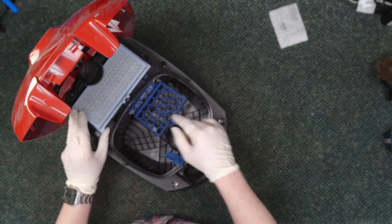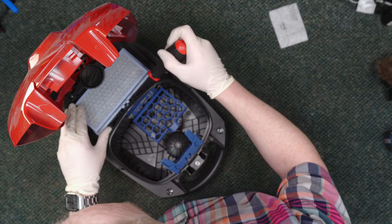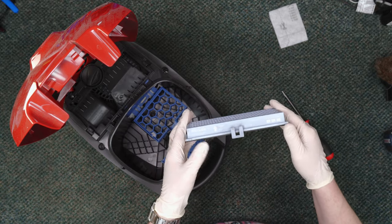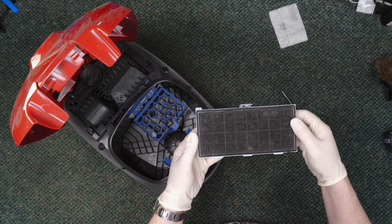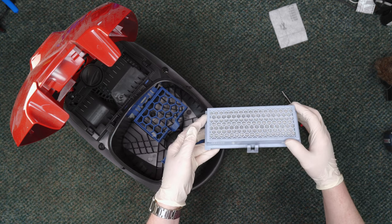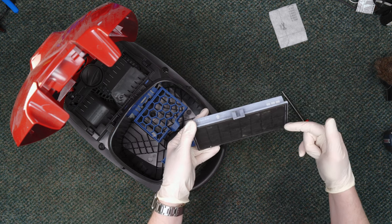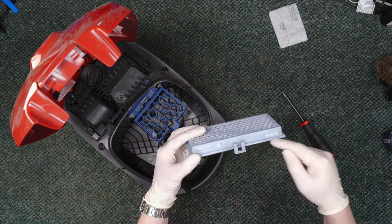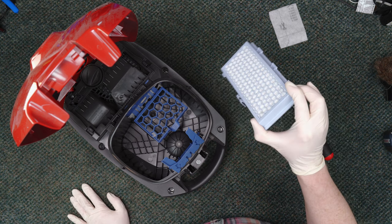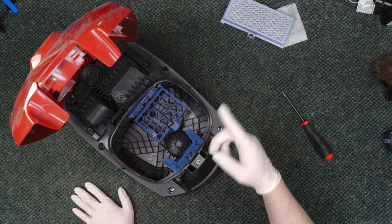This filter, on the other hand, is an old one. You can tell that from the color — this blue frame; they haven't made these blue frames in ages. This was the one that had the activated charcoal combined with the HEPA filter. They called these the active HEPAs. What they did is they split these into two lines: one that just had the activated charcoal with electrostatic filtration, and another that's just the HEPA with no charcoal. The reason they did that is because they were able to get the HEPA filtration numbers down to a smaller particle count using that method.